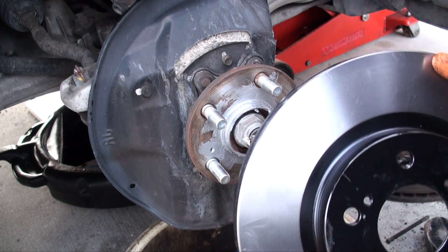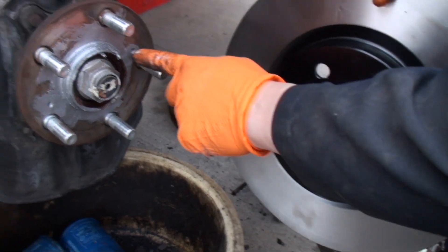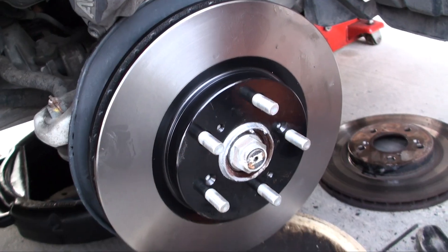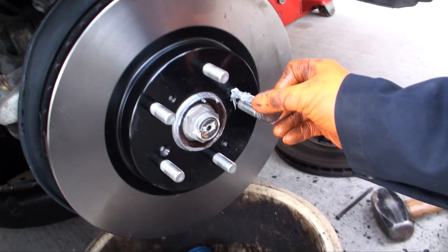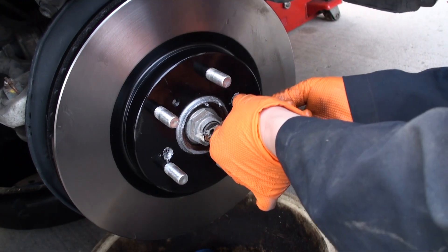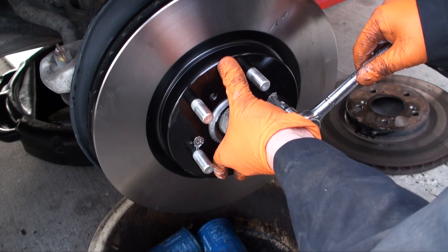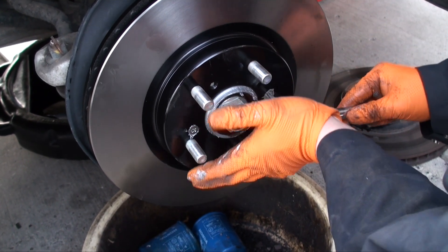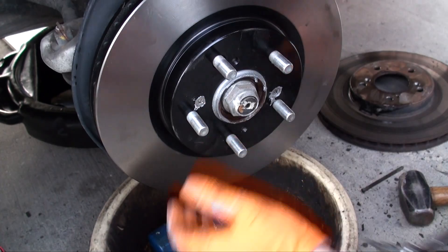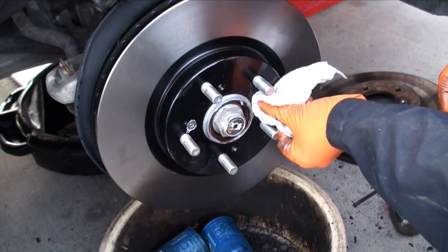When installing our rotors, because I'm reusing the rotor securing screws, pay attention to the countersunk screw holes located on our rotors so that they align with the little holes on the hub assembly. Before we put our screws back on, we also want to apply some anti-seize into these countersunk surfaces, and then reinstall our screws. We want to push the rotor surfaces firmly against the hub, and then just tighten the screws enough such that they just stop turning. You don't actually have to tighten them to any appreciable torque, because it's just to prevent this rotor from wobbling while we're doing the reinstallation. Take a clean paper towel and just wipe off any excess anti-seize.